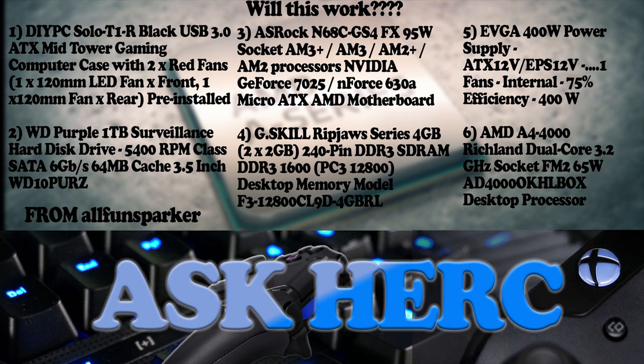Some people build high-end, some go low-end. On the hard drive: the only Western Digital labels I recommend for a standard PC are Blue and Black. Red is for NAS. Purple is surveillance-focused, not ideal for general computer use. Also, 5400 RPM is too slow — hard drives aren't expensive, so the 7200 RPM is totally worth it. I'd recommend throwing in even a cheap 120GB SSD, but if you're on a tight budget, a 1TB hard drive will boot in about 15 to 20 seconds, which honestly isn't that bad.